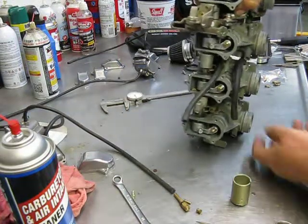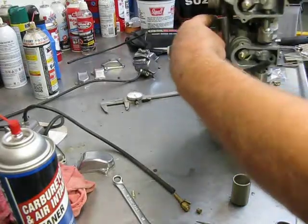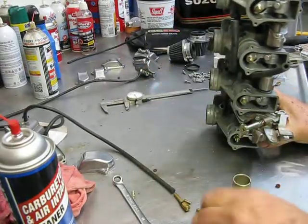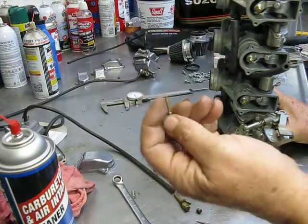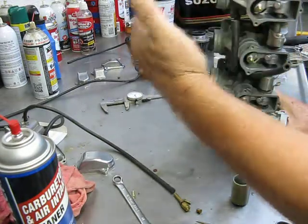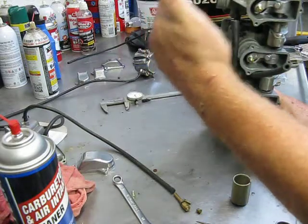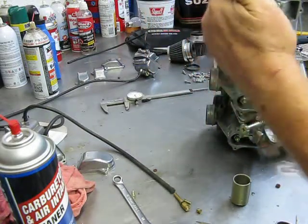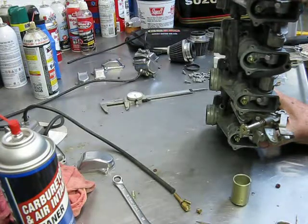But talking about the fuel mixture screws, these carbs also have an air mixture screw, which is a little bit longer, and it does have a flat point to it. And you'll notice it's on the airbox side of the carburetors. All screws on the airbox side are going to be air screws. Airbox, air screw. These two you'll screw all the way in to get your base settings.